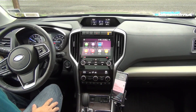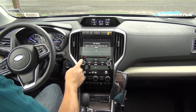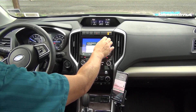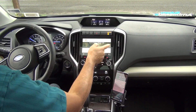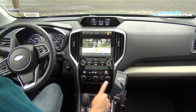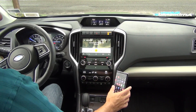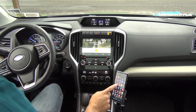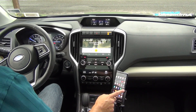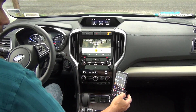The car is going to go into Android Auto mode, and we are going to get our Android Auto display. Now we have Android Auto up. We're going to go back to the phone, unlock it, and get the Android Auto swipe-to-unlock screen. Once you do that, all you need is Torque installed and an OBD2 connector connected to your car that will transmit via Bluetooth to Torque. This works on your Android device and should work on just about every one capable of driving Android Auto as well as running its own display.